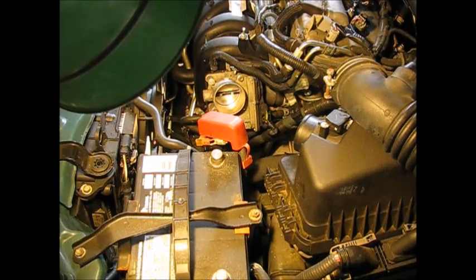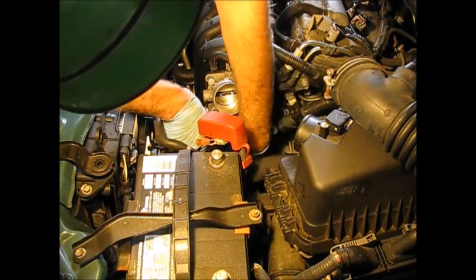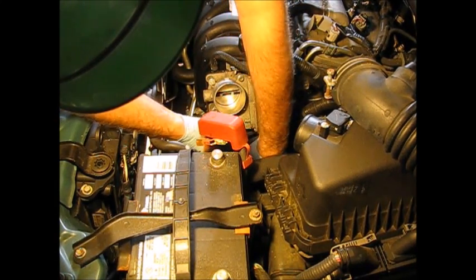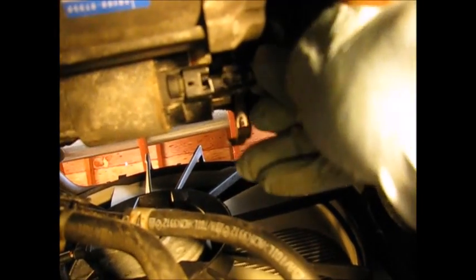Okay, we torqued the bottom up, the final torque. I'm doing the same up here. Don't have a whole lot of room to turn. And you don't have to torque this a ton. It's good and snug. Now for the electrical connections, that's all we have to do with the solenoid is plug it in. There it is, or snap. And from the top we'll stick the 12mm nut on there and snap our cover back over it.